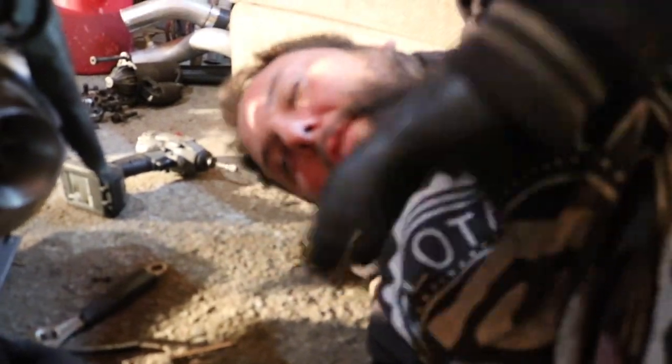And the other thing we're doing is trying to make a lot of horsepower. Because of my turbo. Yes, thank you, Evo Shop. If you guys don't know what this turbo is, it's a T04E Turbonetics 6062. We're at a 0.63 A/R exhaust housing. Good for up to 600 horsepower. That was tech talk from Sean's chin. I'm gonna have to put a photo of my car over that section.